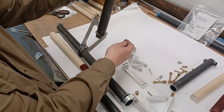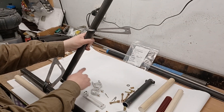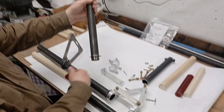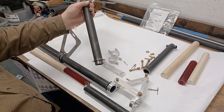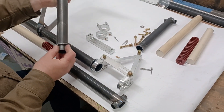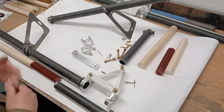The gear sits on the airplane with the gear forward, so the scissor assembly is aft — in the back. The two little slots allow you to set your toe-in and toe-out after the whole assembly is on the airplane. You won't shim with washers or anything like that — all adjustment is done in these slots. Tighten everything up with the AN3 bolts, and don't forget to rivet those three stainless rivets in place.